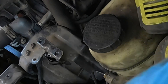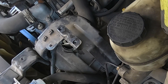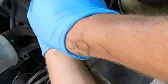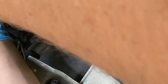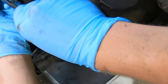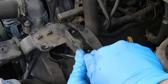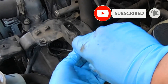You can see I lubed up the new solenoid before inserting it into the hole in the valve cover, then into the cylinder head. I'm going to set it in there to get it all started softly — I want to make sure the solenoid slides in easily, the screw starts very easily, and nothing is cross-threaded or sideways. Just take time, take a look at everything, don't go fast, and torque everything down. Get the right tools if you can.